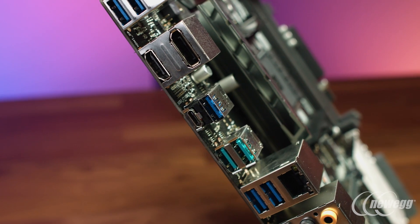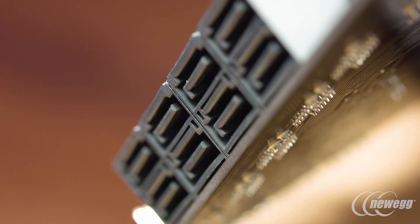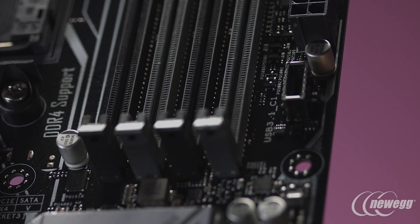For those looking to create a parity perspective relative to something like our Z270-A, the X370-A pretty much offers the same level of key specification support: USB 3.0, USB 3.1, M.2 with NVMe support, x16 PCI slot support, PCIe Gen 3, SATA 6G, and innovations like a new front USB 3.1 header. Whether you want to use the latest NVIDIA 10-series or AMD RX-series graphics cards, both are fully compatible, including our white Dual series and high-performance Strix series cards.